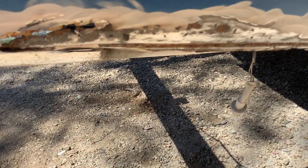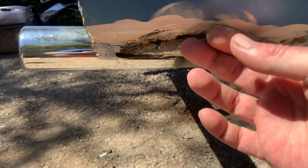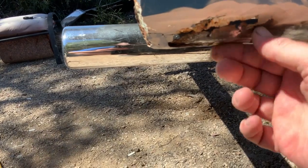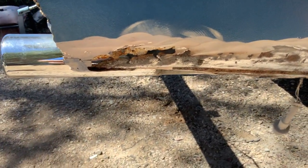I guess in this situation it's better for me than if they had just put Bondo right over the rust, because then I wouldn't be able to get it off. At least once I peel off the aluminum foil, the Bondo is not stuck to the rust. But obviously I'm gonna have to cut some of this out and replace it, get it clean, get it back down to bare metal.